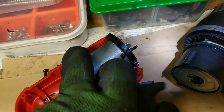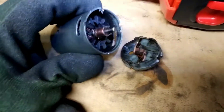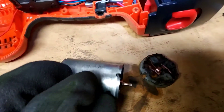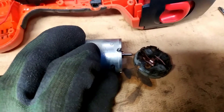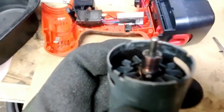I can hear this noise now. The most difficult part was taking out this cover — this lid with brushes from the motor. What I did was cut these two clips with a Dremel because the plastic was too thick to use a knife or anything else.